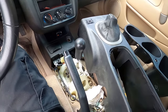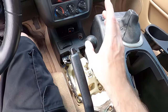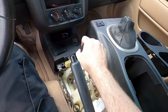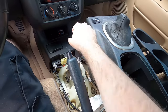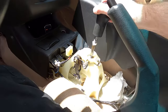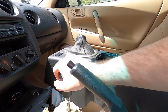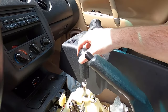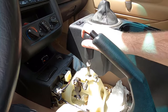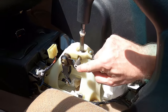Hey, it's Kilobyte here. I've got this 2001 Mitsubishi Eclipse 3G with the five-speed manual, and it has the all-too-common left-to-right difficulty in moving front and back. You can generally still drive it, but if you put it in neutral it stays to the side. Before I started messing with it, it was hard to even push to the sides. I took the console apart and have been looking at the linkages — there's a little wear right here, but that doesn't seem to be the problem.